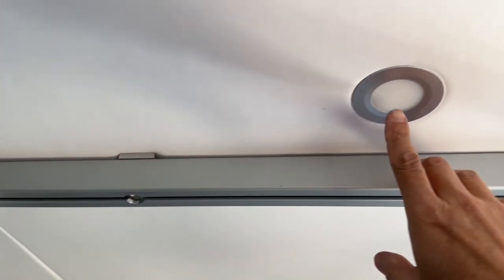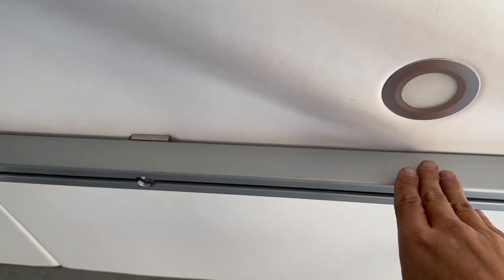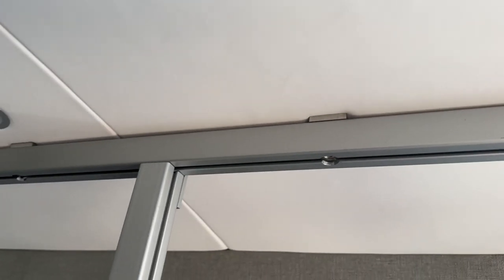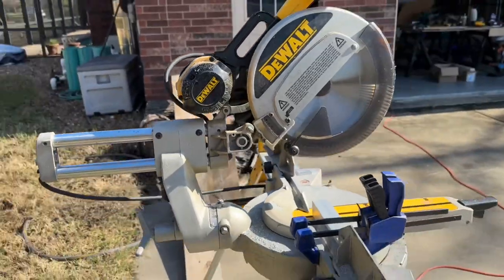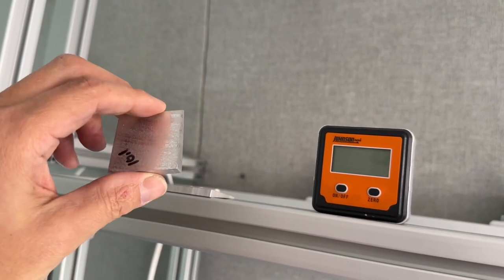The only issue with this is it drops everything down, which was perfect for these cabinets. But up here, when I put in my plus nuts, I had planned for my lighting and I had planned for the distance — so I didn't have room to bump this out any further, otherwise I was going to be covering my lights. So I had to come up with a different solution: I used the chop saw to cut these wedges. This is a 10-degree wedge.